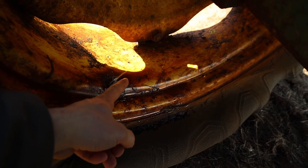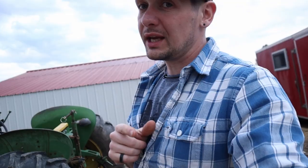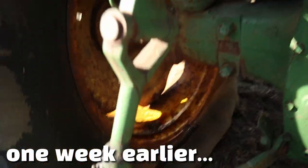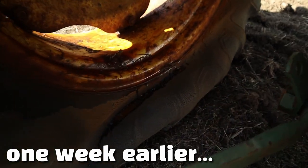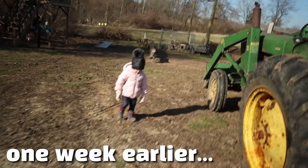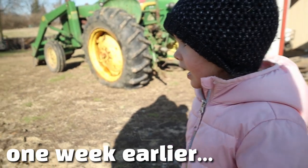It's not just flat where I put air in it - obviously I would have done that already. It's flat because it's leaking around the valve stem. I was thinking maybe it was so rusted out that I was going to have to weld something on the rim, but I'm hoping I'll just be able to replace the valve stem.